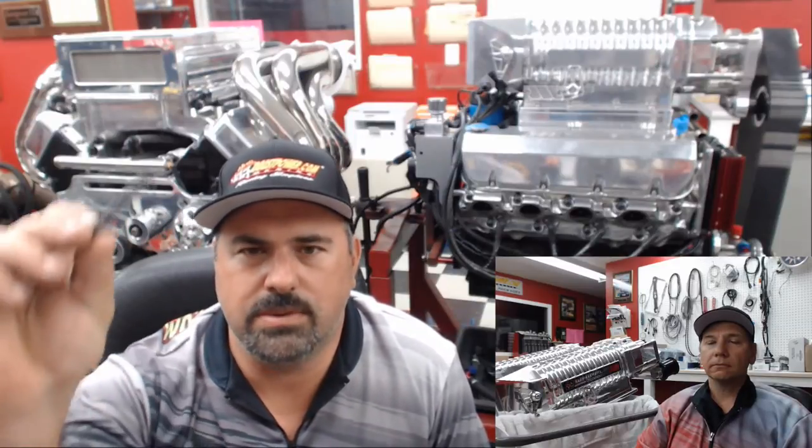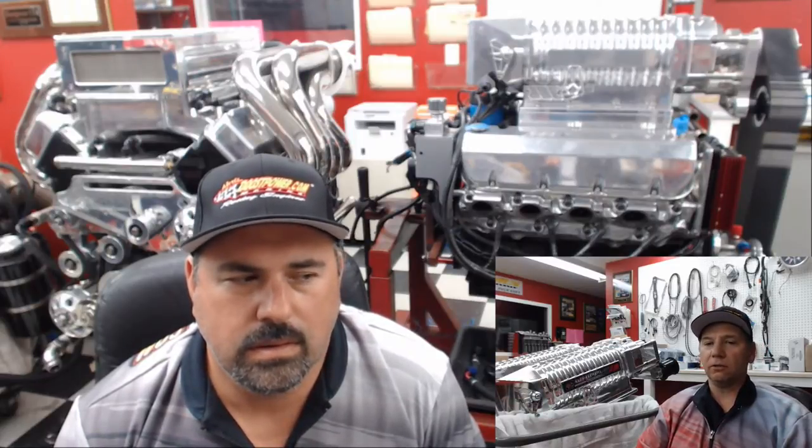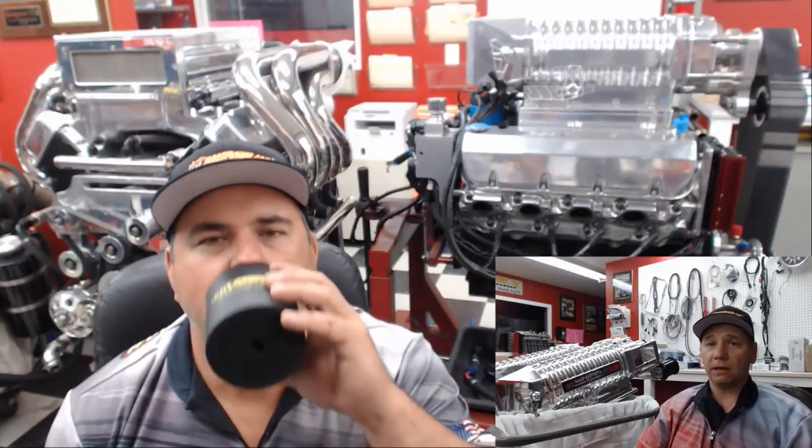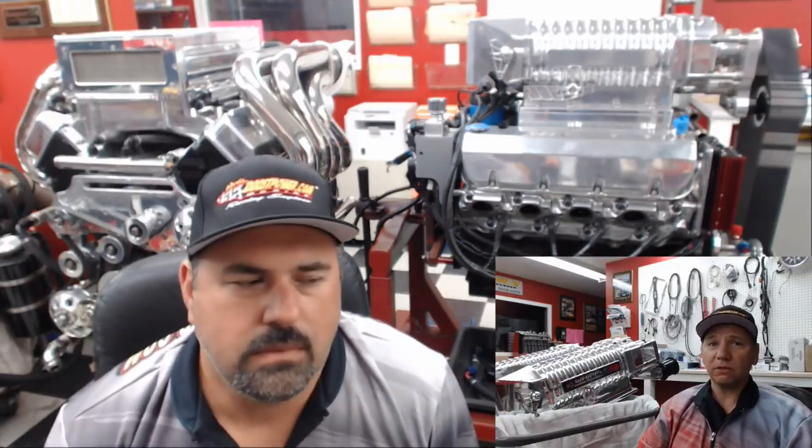On small oil pan boats, sometimes oil pressure can start creeping down at high RPM — just make sure it doesn't stop stabilizing. To experiment, you have to drop the oil pan, which entails a lot of work. We use dyno testing as our experimenting. For the average guy building a motor, you really need to know the combination and how much oil volume your engine requires. If you have too much oil pressure and the engine isn't set up to receive it, you could actually reduce horsepower and put quite a load on the system.